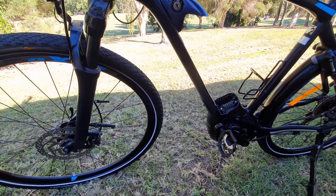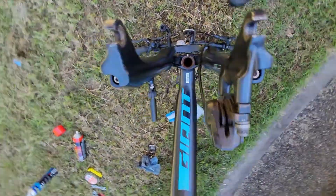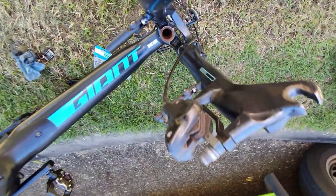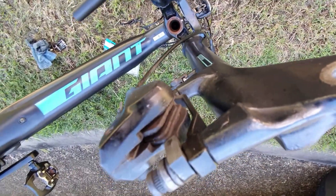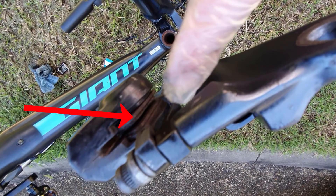So that's the bike flipped over. I'm just going to do one set with the front wheel — it's easier to show. You can see the brakes with the wheel off: that's the caliper just in the middle there, and then the split pin is just here.